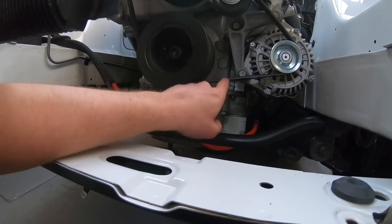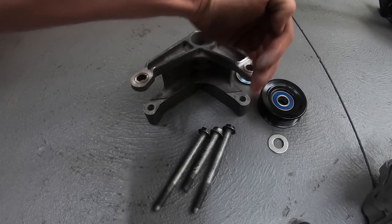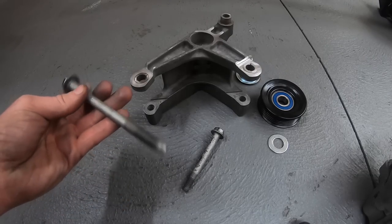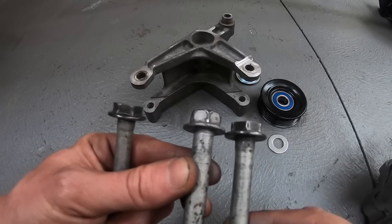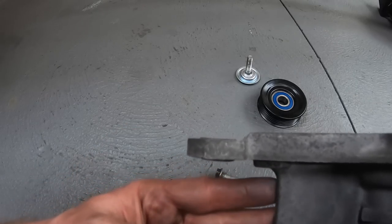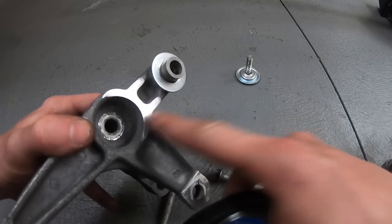With a standard crank pulley you'll still have the top bolt problem. The belt runs right across both bolts and touches the bracket head. I was going to countersink them but it was too much hassle getting the right bolt lengths since these are pretty long. So all I did was shave the head of these bolts down — just a couple of millimeters. I've also shaved down the bracket where the pulley sits, taking a few mil off with a flappy disc on the grinder.